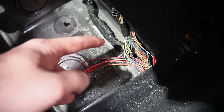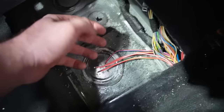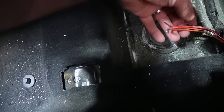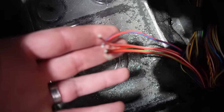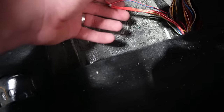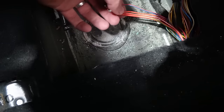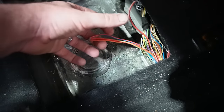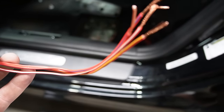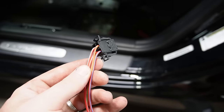Alright, I moved all the other cables out of the way. These are the four wires that are ripped off — they're all off one connector, which makes things a little easier, and they are thicker wires. Unfortunately they are corroded, so I'm going to cut back maybe an inch for each one and hope that's as far as the corrosion goes. About 15 minutes later, I got all these stripped down and looking fantastic — the new connector has no corrosion.